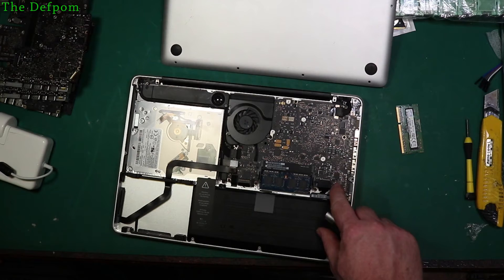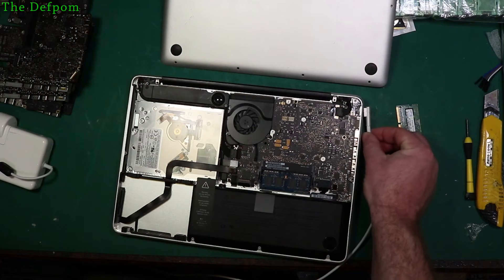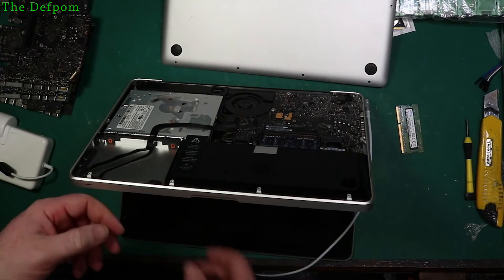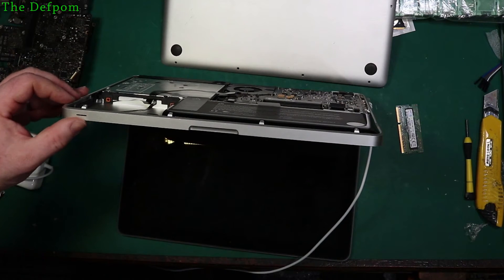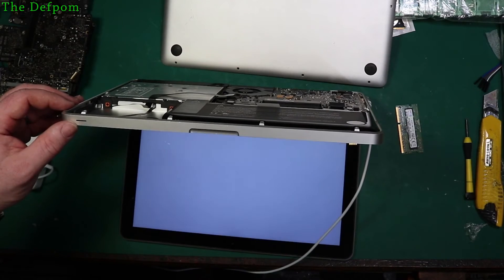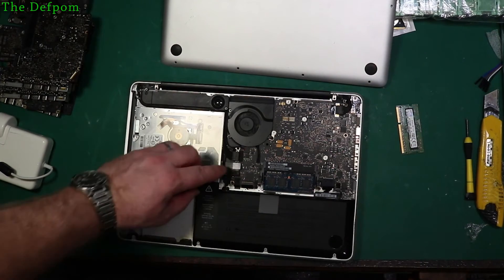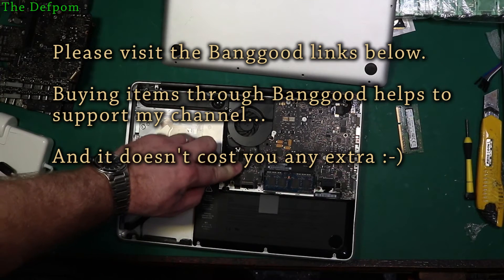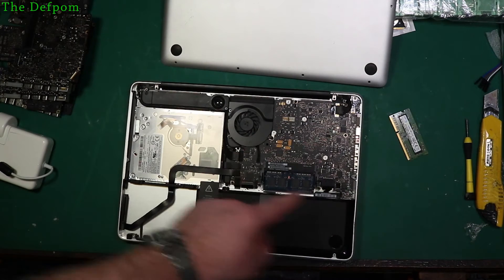I'll do a couple of things at a time, let's try that first. It's not as simple as just going around and seeing what is loading it down. This is looking good — that's working. So it's one of those ones. Let's plug these two things in, which is the hard drive flex, which is often a failure point. Try that one as well. I think I had that RAM in there before — maybe it's just a bad DIMM.